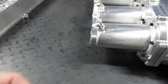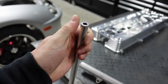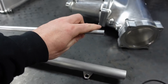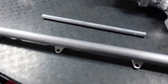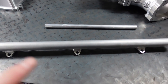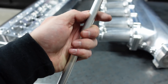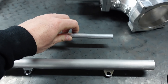The only other different thing is this random tube. There are three spots here — this is used to bolt up, and you have to figure out the bolt length, then cut down this tube depending on your injector length. This is good for some people, bad for others. This one comes with a predetermined length and you have to figure out your injectors. But with this setup, it allows you to cut it and make it whatever you want. It's just a normal piece of aluminum — you can probably go down to Home Depot or Lowe's and get this. Really like that. Super nice little piece. The billet adapter is designed for the 82mm.